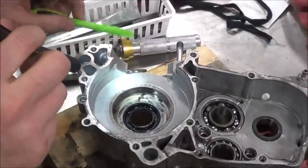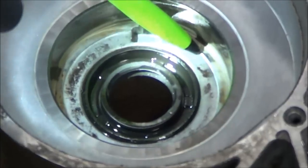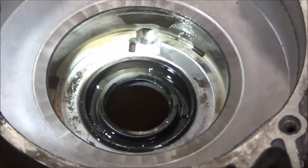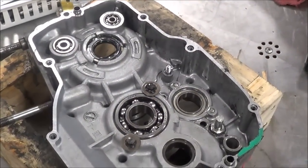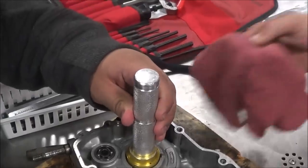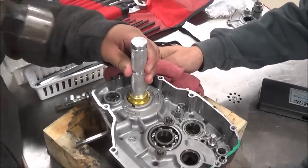The thing I wanted you to see is the relationship between bearings and seals — they don't touch each other. Do you see how Kawasaki has this machined lip that's higher than the flat surface of the seal? The bearing is going to bottom out against that. Mason, come over here — this is your motor George, this is yours too. Go ahead and drive that seal all the way off. This one will go pretty easy. You know, I love his technique — go ahead and keep going.